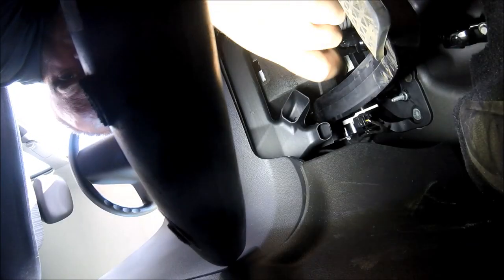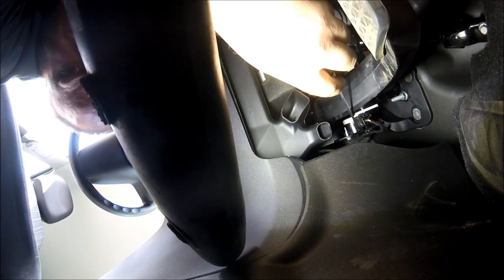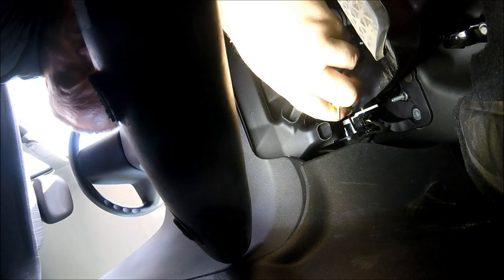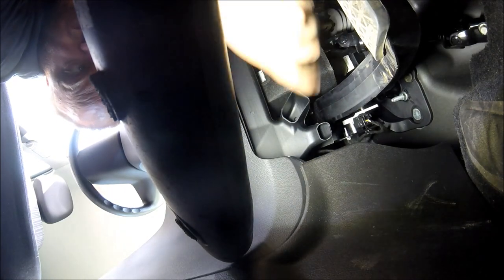Right, we're in the car now. This is the clutch pedal here. I can see the sensor over here — basically pointing to it now. Right by it you can see the little bolt at the front just up the top there. Basically that's the little arm which locates into the actual pedal. You have to lock the dowel in first, rotate the body, then stick the bolt in. You need a little 7mm spanner. It's up in the car underneath the dash — very easy to get to. You don't even have to take any of the covers off; it's very accessible.